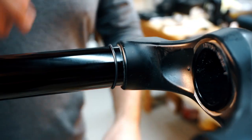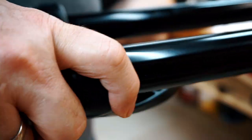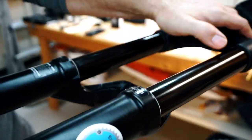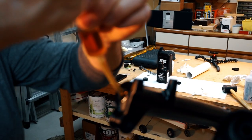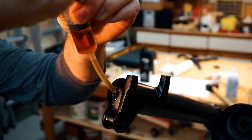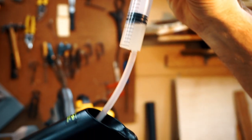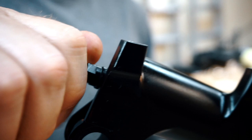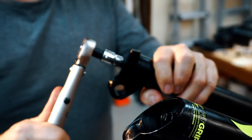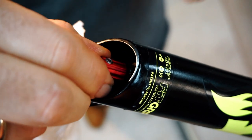Replace the old o-ring. Step 6. Reinstall the lower legs. Carefully slide the lowers back onto the fork, taking care around the seals. Add the right oil to the bottom of each leg — for a Fox Grip fork, add 10cc of 20 weight oil to the air spring side and 40cc of 5 weight oil to the damper side. Give the fork a final wipe. Reinstall the nuts with new crush washers and torque to the appropriate setting. Finally, reinstall the damper knob making sure it lines up correctly.